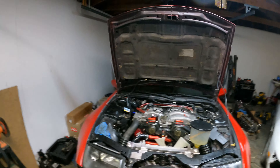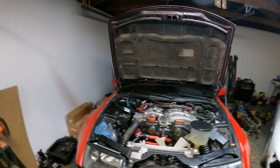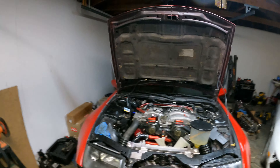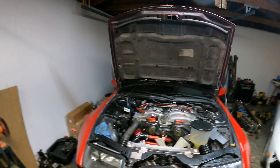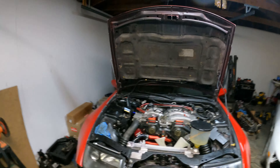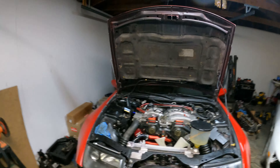It's a little smoky in here — I think we've burnt almost all the oil off now. Coolant's about completely done and hasn't gone anywhere. We're currently idling at 800 RPM, which is exactly where we want to be, so I don't need to mess with the idle air control.